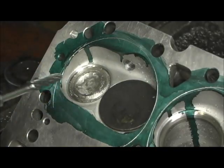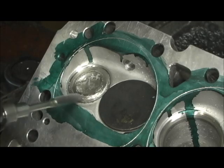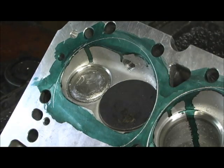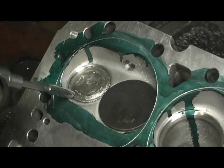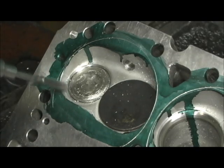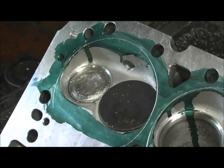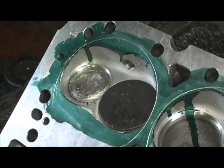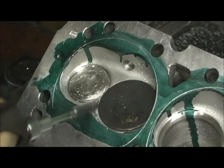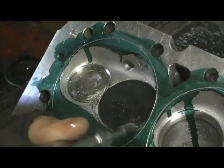I'm going to take my finger pointer and blend it downward. It's one of those times I wish I could show you up close the amount of ridge — it's not much, but it's enough that it would aggravate the air flow. A little bit on the intake side, not too bad. It's mainly on the exhaust. But I do go in here and do some digging right here.